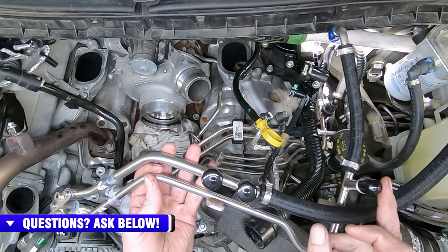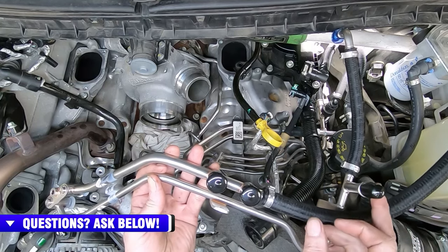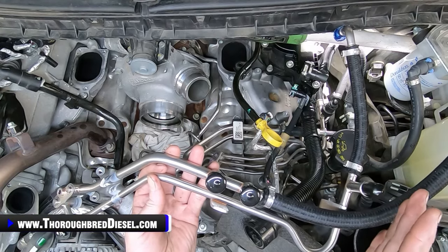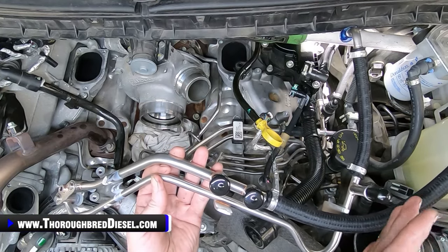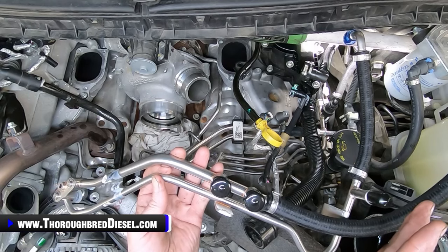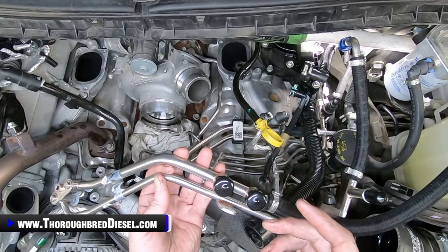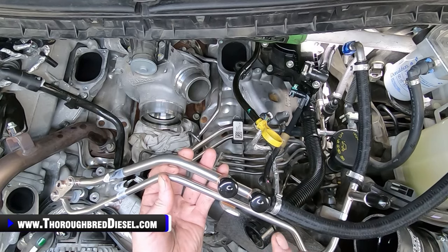This is where our DPK, our prevention kit, adds filtration, which is not needed with the DCR conversion, but it doesn't hurt a thing to leave it in. It's just an extra layer of protection for you and keeping fuel clean. So that's cleaning the return fuel that's going back to the tank. So we're leaving it in place here today.